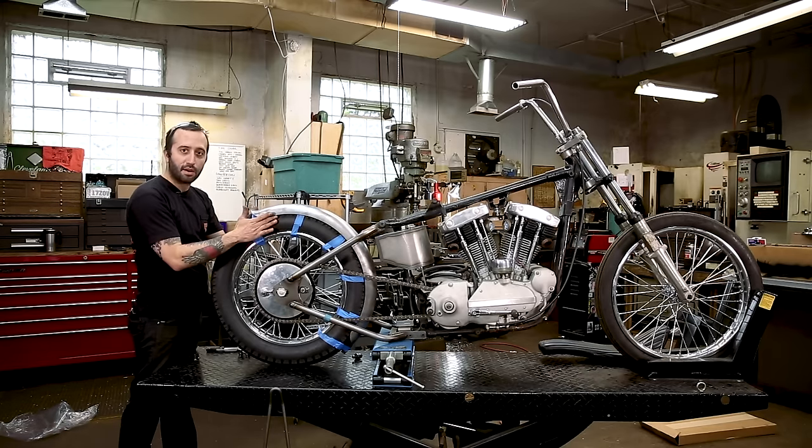I already have the one I'm going to use, and it's pre-cut. I just wanted to show you what it originally looks like. This one has a couple bends in it because it fits nicely on the curved fender. And also if you run a rib fender, it gives you some space in between for the rib to go, so you don't have to flatten out your fender or cut it up or anything like that. And the one with the two bends in it comes with these bungs that you then will just weld to the top of your fender.